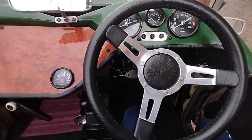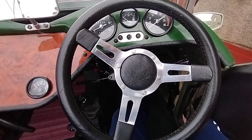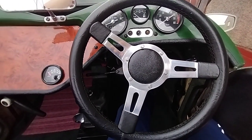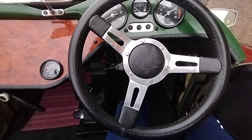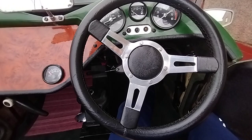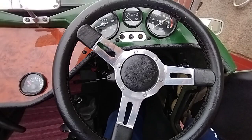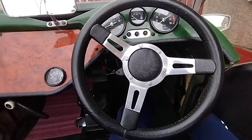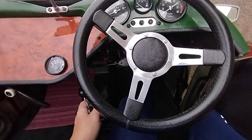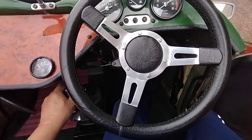Left hand side inside the car — it's had another head on it at some point, looks like a new head, but the one on this side is probably the original, so it may have the same issue. We'll soon see when we open it up. It could be the rocker shafts — I do have a rocker shaft coming. It might even be the actual rocker, maybe a wee bit of wear in it. If you bring the clearance down a little bit, down to 0.15, it doesn't make the noise, but it's advised to keep it at 0.2, so 0.15 is fine.